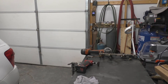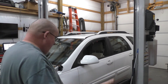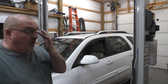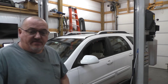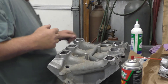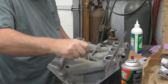Kind of keep in mind that you don't want to clean parts if you have an open engine sitting nearby — although it's covered up, you still don't want to do that. Stay away from it, be on the other side of the shop, make sure that none of that dust gets all over the place. All right, we'll build the intake. Intake runners — I'm gonna check those real quick.